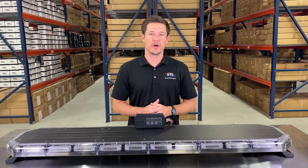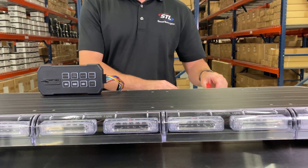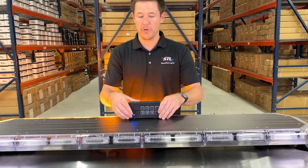When you go to hook up your light bar using our supreme control box, you'll simply plug your connector into your supreme control, and then I went ahead and ran my main power cables — my red cable to my positive connection and my black cable to my negative connection.